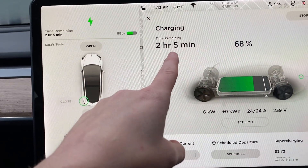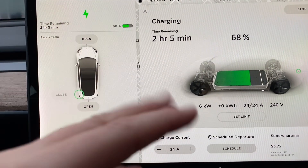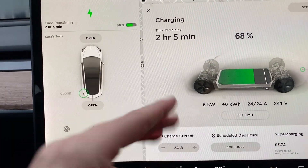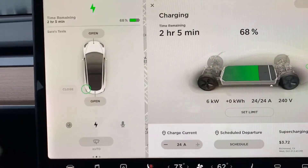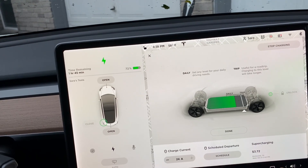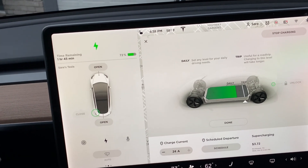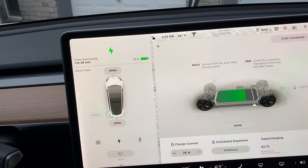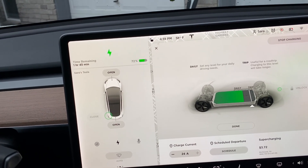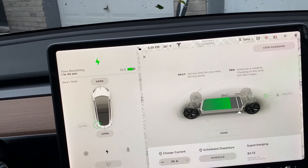For roughly 20% of battery — basically 70 to 90 — it takes about two hours. Supercharging will tell you how much it would cost; it's more money at a supercharger because it's more volts, but it charges way faster — about an hour for a full charge, whereas at home it takes about 11 hours for a full charge from zero to 100. At superchargers you're basically paying for the time you're not having to waste charging.